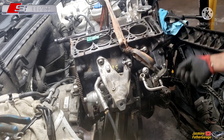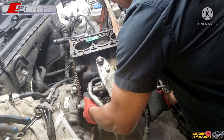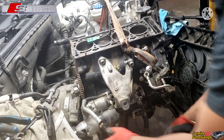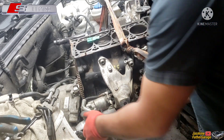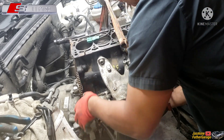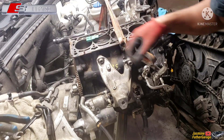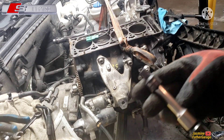For the engine mounts, so that the starter will come out. It probably could go like that but the cable is in the way. You're going to have to take out this bracket, both on the top and on the bottom — 12 millimeter, 12 points.